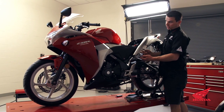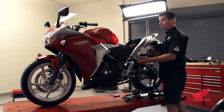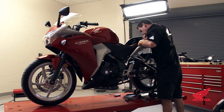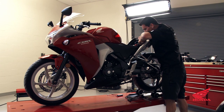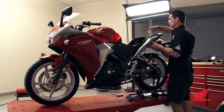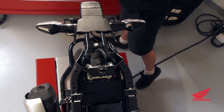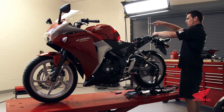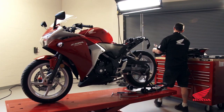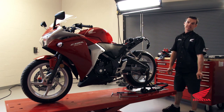There's a barbed clip on each side — just pull and it'll pop off. The whole thing should slide back; just unwind the lock cable from the seat lock and the whole tail section slides off. There's one more bolt for the license plate bracket. The entire stock tail section has now been removed.